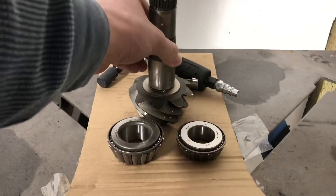The second part of this video is going to be a little bit different. We're going to slow it down and take a look at the specifics of setting up a ring and pinion and differential in your 12-bolt car or truck rear end. Now, obviously, this is a truck rear end. There are some slight differences with some of the bearing preloads with the car, but for the most part it's about the same — you set up a ring and pinion.